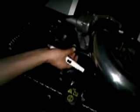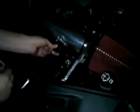Okay guys, so using my trusty lighter here, I was able to melt this, and although you have to excuse the low quality of the video, it did fit snugly, and this should not pull off. It's still a little hot, but that should stay snugly there. The other part, like I said, you just slide into the nipple there, into the intake tube. The final two steps we need to take now: we need to reconnect the air sensor. Just slide that there until it clips.